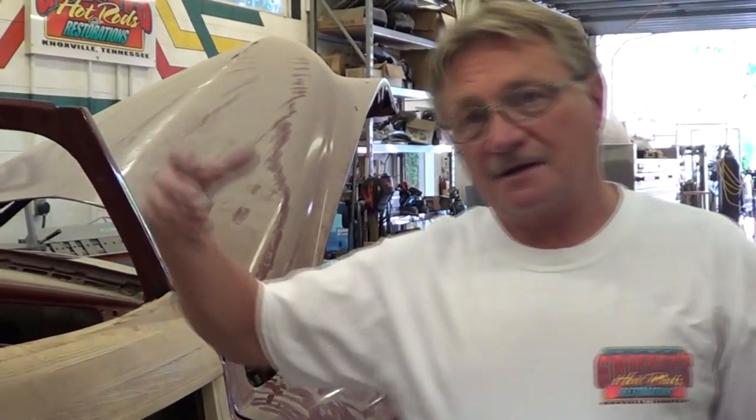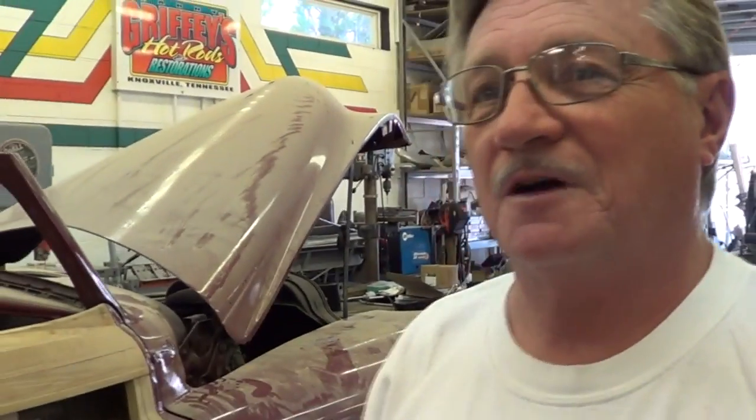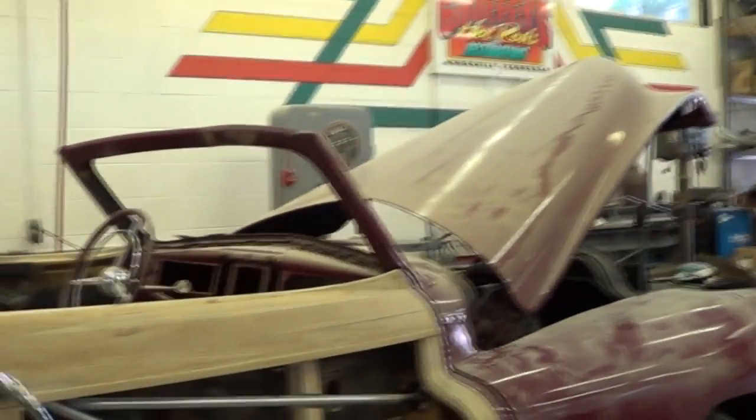So we're probably going to do those in wood grain, like dashes were done in most cases. We have a person we work with — Wayne Marston — who is very, very good with his wood graining and can match the grains so it will look just like mahogany veneer. It's a painting process — a wood graining process. A lot of antique cars had wooden wood-grain dashes and garnish moldings that were not wood at all; they were metal grained with paints, chemicals, dyes, and stains. Burl dashes that Fords, Chryslers, and Lincolns used were all done that way.